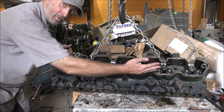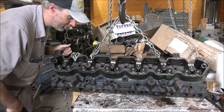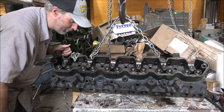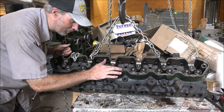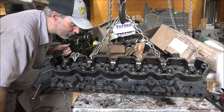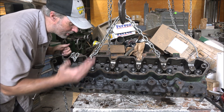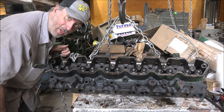You can see all the beautiful hardware on here — got a good set of pack springs and lock cap retainers on here. That's all manly stuff. Gives it that big stem again like it had when it had the 7/16 valves in it, because it's only got three-eighths now. Full set of bronze guides, spring locators, everything's all shimmed up to the right pressure, so should be good to go. Thanks for watching, thanks for subscribing, and I'll catch y'all later.